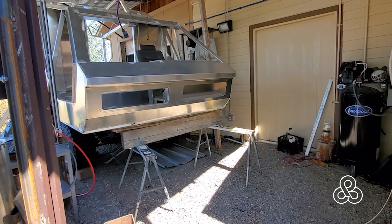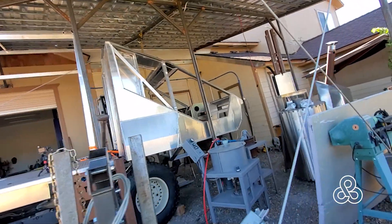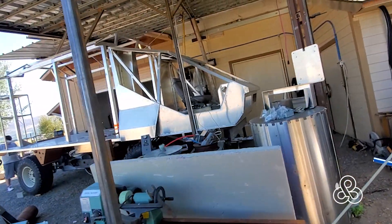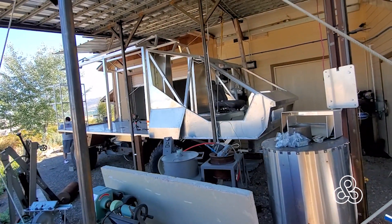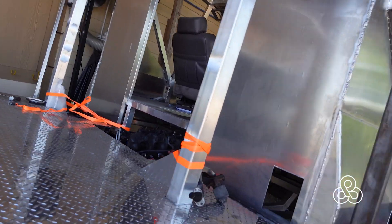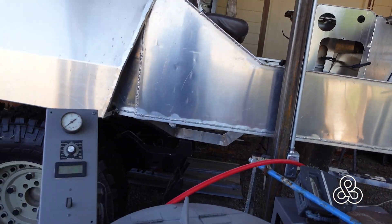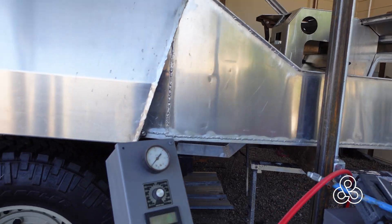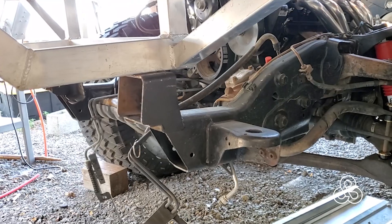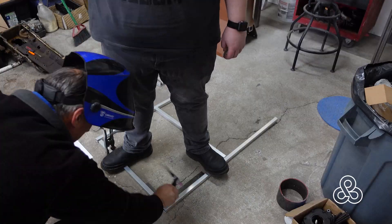We had to lift the nose up and set it on a couple of sawhorses to get it level. That's where it's sitting right now — everything's in position where it needs to be, a couple of straps holding things in place so nothing moves while I build the cab mounts. You can see the engine access panel there, front and back. Here is the frame of the cab sitting down on the chassis nose, and we'll be building some mounts there that will pivot and allow the cab to swing forward, with some shock absorbers in the back for the rear connection.